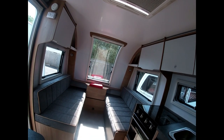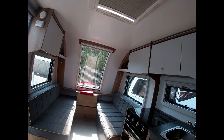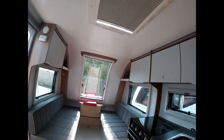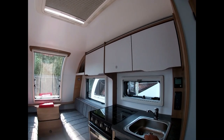You then need to come into your van, go under the seat and change the yellow lever from a vertical upright position to parallel to the floor. Once you've done that, you can go around and close all your taps, one, two and three. Once they're all closed, you can switch your master switch on and your water pump on.